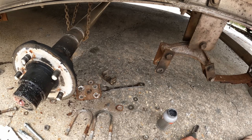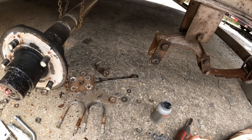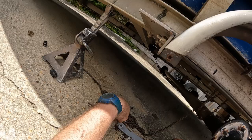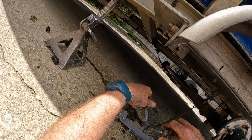Even though these are stainless steel bolts, you still want to use anti-seize on them because stainless steel will gall between the bolt and the nut. We're going to put some on the whole shank of the bolt — we've got a washer on there. Take our first spring, line it up in the spring hanger. It's not a bad job, about a two-hour job to do this. Don't let it go, guys — don't wait till everything breaks.